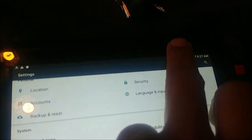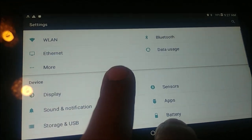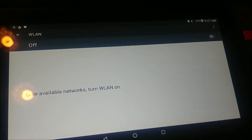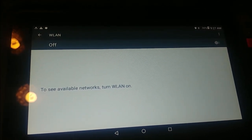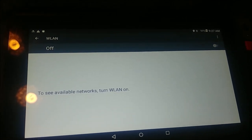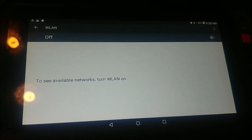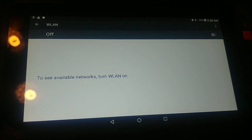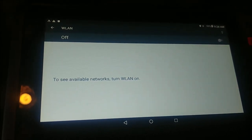Also regarding wireless: if you're not actively updating your Adventure Pro software, turn your wireless off because it will consume your battery. Your Adventure Pro won't go into sleep mode while still connected to your network, so turning wireless off when you're not using it will make your battery last a lot longer.